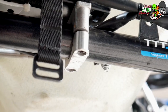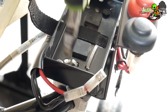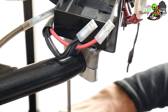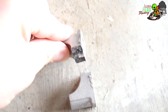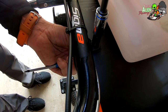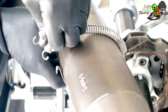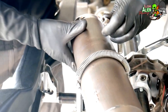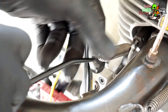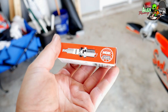That's the battery tray right there, and the broken clamp — the top portion of this clamp is broken. I noticed it was loose when I was warming the kart up before a race, so I had secured it with zip ties. I got the part, so now we're going to replace it. When we get it off you can see it snapped, so we replace the broken portion. The bolts holding the skid plates on the bottom — which protect the frame — were sheared off, so we replaced all those. You can see once we put the new ones on they're recessed into the skid plates and look really nice. Doug is reinstalling the exhaust pipe with four springs.